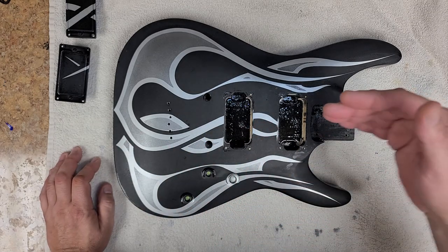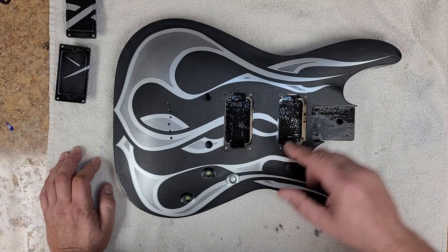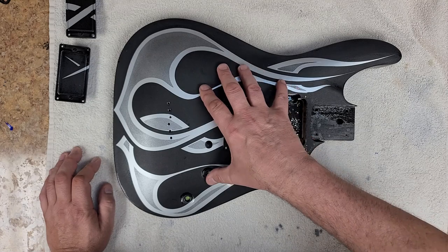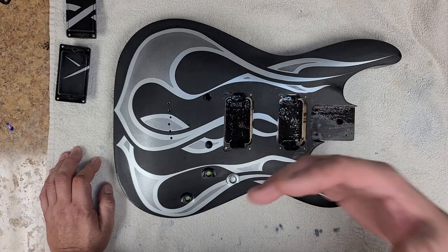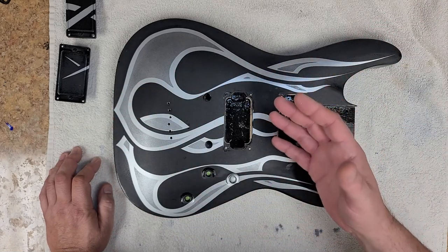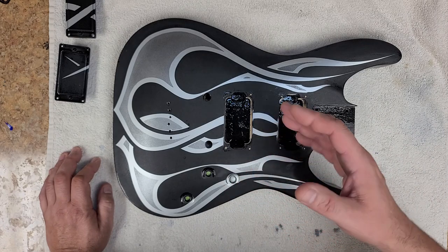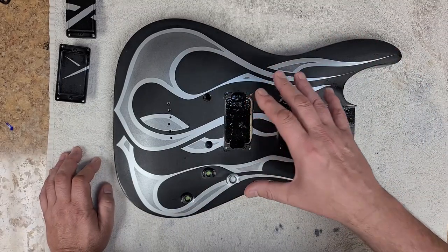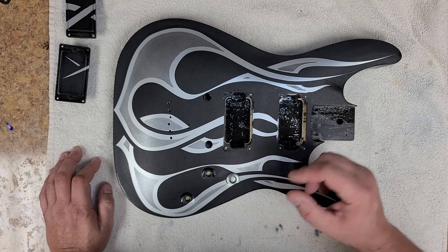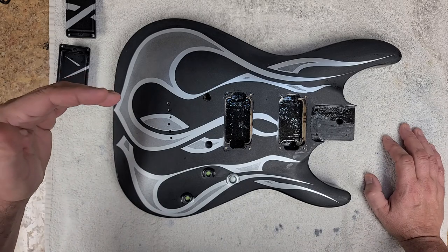Having a clear coat on top of this body makes it really easy to remove those little flaws without disturbing the black diamond base coat underneath. If you have some sort of problem it could look funny once you put your candy on, and then putting clear on top of that — a lot of stuff is going to pop out that you may not even have noticed during the build. So the clear makes a big difference; you want to make sure little flaws are taken care of before you apply the clear coat.